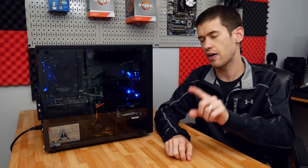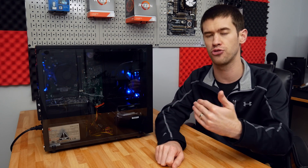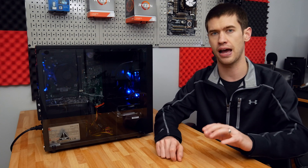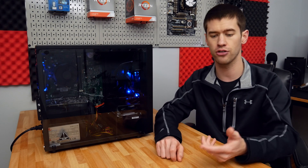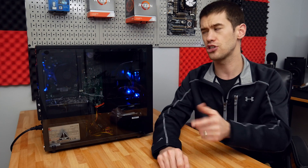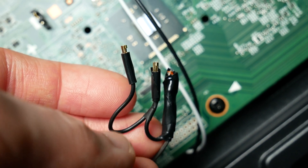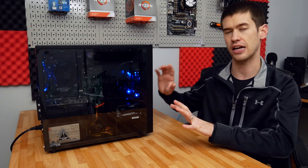If you're interested in how I got this Inspiron 3847 transplanted into the Deepcool Matrix 30 case, go ahead and check out the last video linked in a card or in the description. Basically, the Inspirons from this generation — featuring fourth gen Intel processors — don't have a lot of the sensors that older Dell Optiplexes have that make transplanting difficult. The front panel is pretty standard: two-pin connectors for the power button, LEDs, USB, and front audio. There was just a little bit of soldering needed to short out some pins along with the power button, and once that was done it was good to go — a fairly simple process.